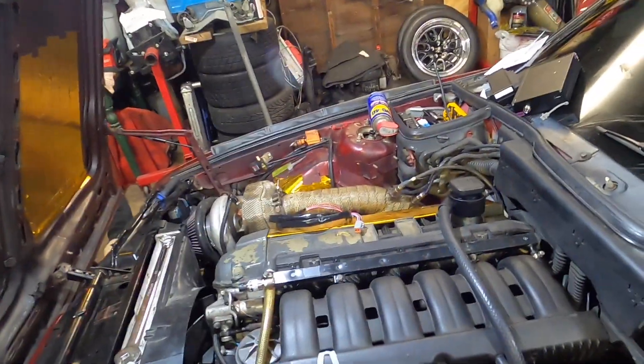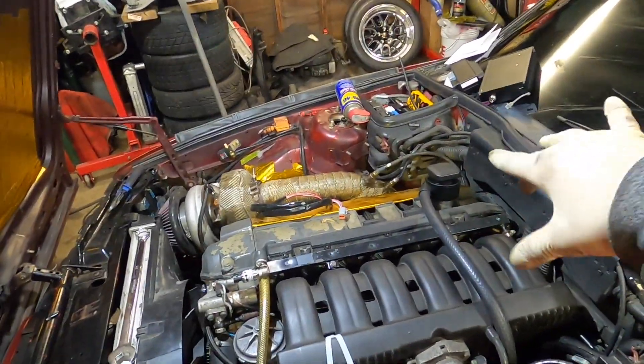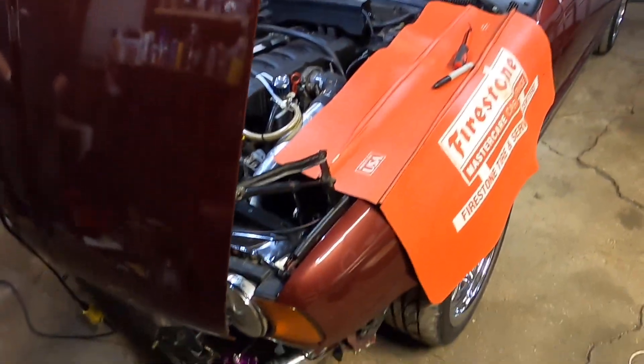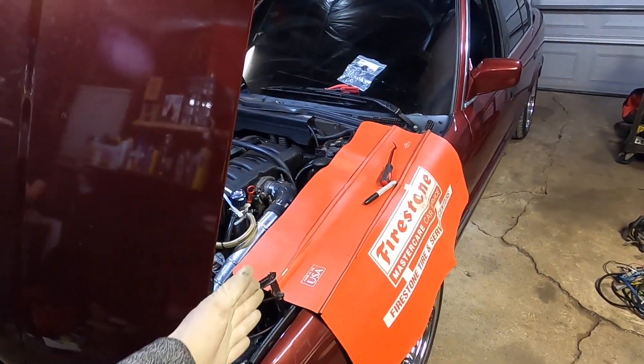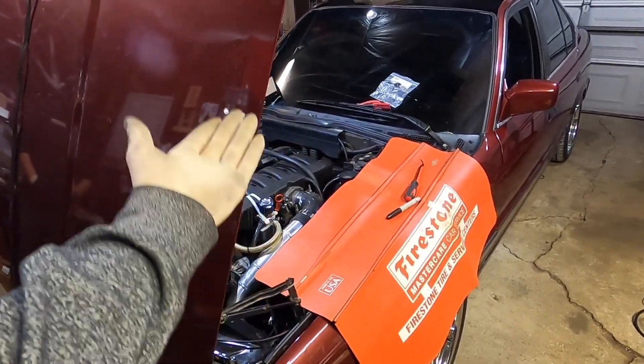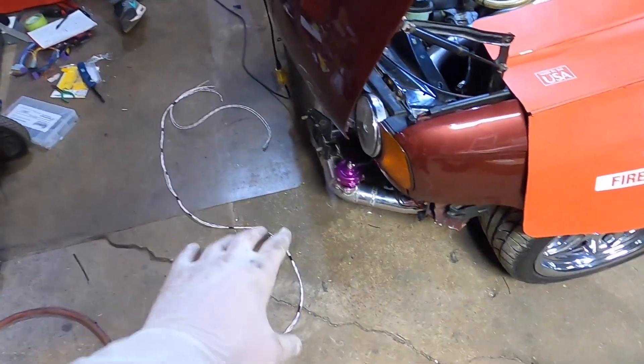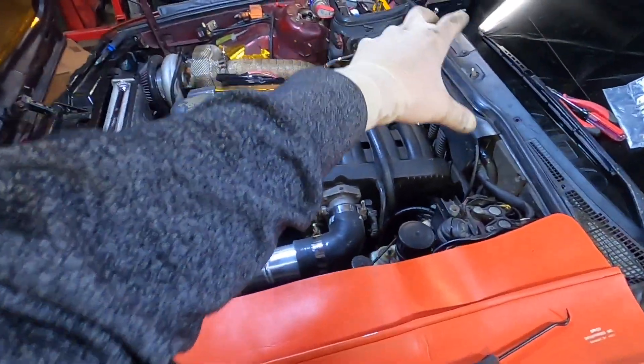Because if it were me it would probably just be wires across the top of the engine. Here we have the whole harness laid out: it goes into the E-box into the standalone, down to the boost solenoid, then wraps around the back of the firewall around the shock tower, goes into the IAT, and then the fuel pressure sensor. Now it's got to be loomed and it'll lay in here very nicely.